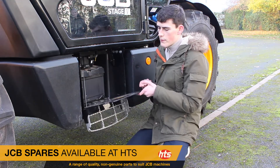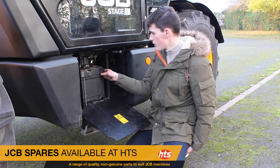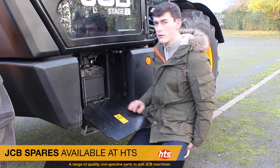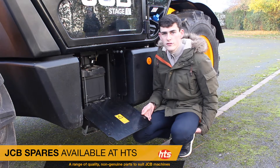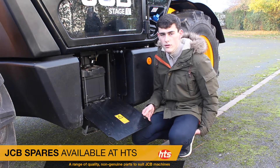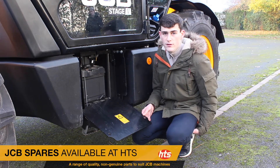The first thing to do is to unbolt the protector and then make sure the terminals and the battery are clean, and anything — the cables you're connected to the battery — are clean. With the increased draw, it's a good idea to check there's not any corrosion on the terminals that would affect the charging.